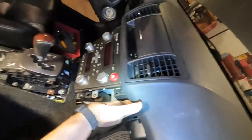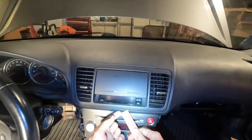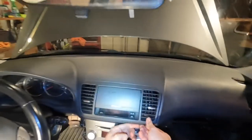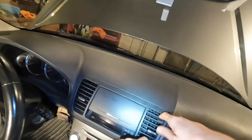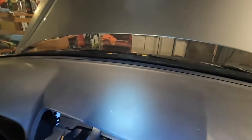This one is trickier. I like the side vents — you want to be gentle with these because our dashboards are old and dried, they want to crack. Use a flat trim tool, tapered, get to one edge, then start lifting without grabbing the rubber. Get a finger in there, pop that side, pop that side. There's going to be one pigtail for the clock and temperature.